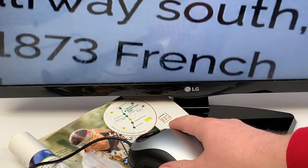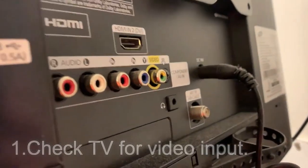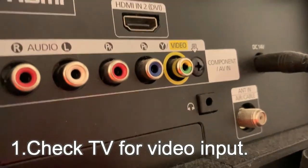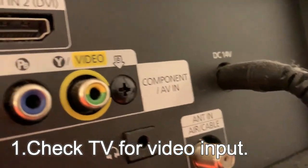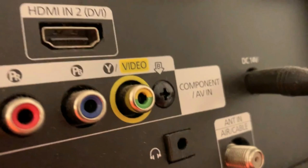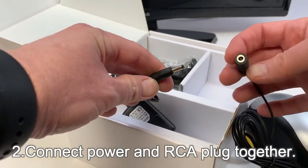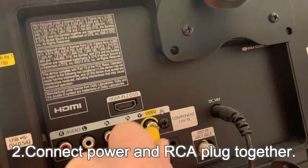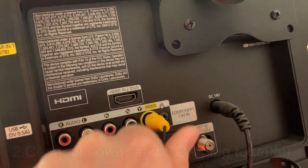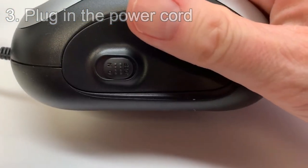Using and connecting the magnifier is simple. To use this product you must first make sure your television set or monitor has a video input. This is normally on the back of the television and is yellow, with the words input noted beside the red audio and white stereo inputs respectively. First connect the power cord and the AV video input together. Then connect your yellow RCA plug into the yellow RCA input on the back of your television set. Plug the power cord into an outlet and switch your magnifier to the on position.